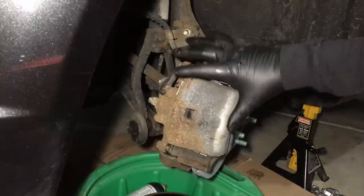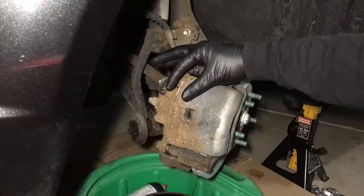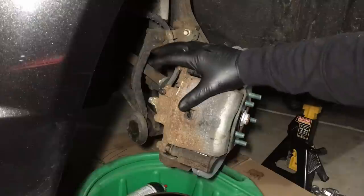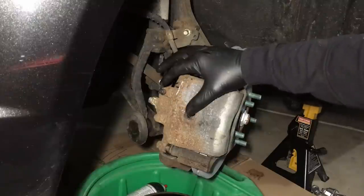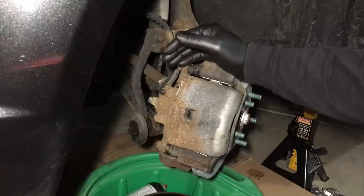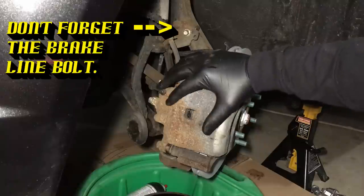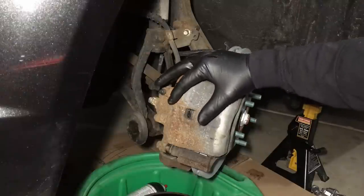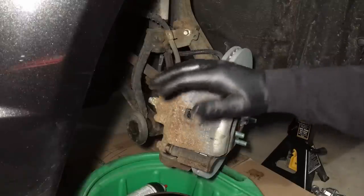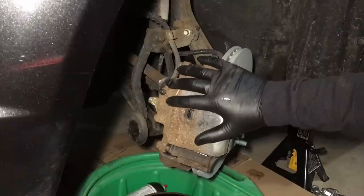The brake job is done. Just repeat the same procedures for the other side of the vehicle. We pressed the piston back into the bore and that pushed fluid back into the master cylinder — no leakage came out and it did not overflow. If you don't have a suction gun, after the first side get into the vehicle and hit the pedal until it's nice and hard, then go on to the other side. When completely done — wheels back on, everything torqued down and secure — go into the vehicle, leave it in park, start it, and push down the brake pedal a couple of times until you get a nice hard pedal. Then you know you're safe and ready to go. Hopefully this helped — I'll see you next time.